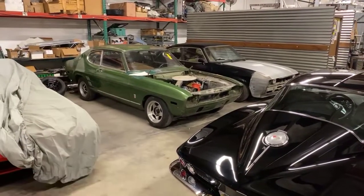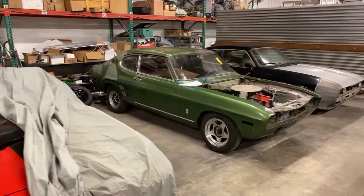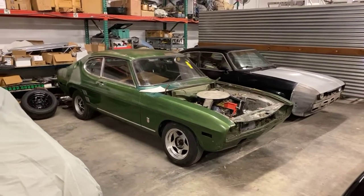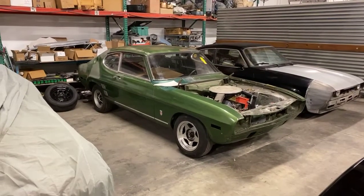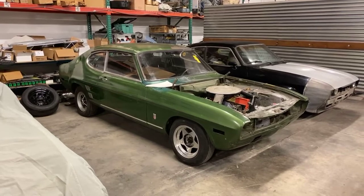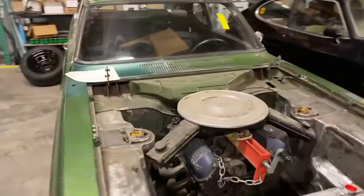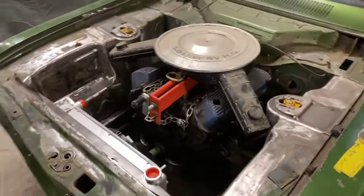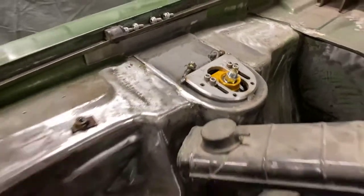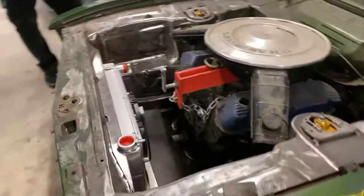What have we got over there? That's a 1974 Ford Capri — those are built in Germany. They're a cool little car. What are we doing with this one? We've made a lot of mods — we pulled out the two-liter four-cylinder and put in a V8 302. So it is a Ford and a Ford at least. We modified the front suspension — this is Datsun 240Z front suspension. I modified all the towers and changed the strut lengths, but everything else bolted in exactly as needed.